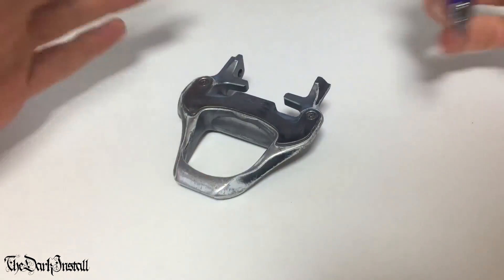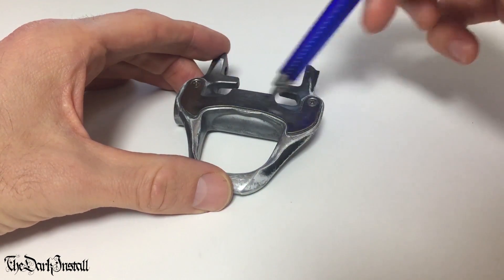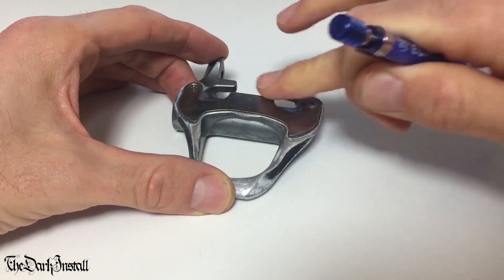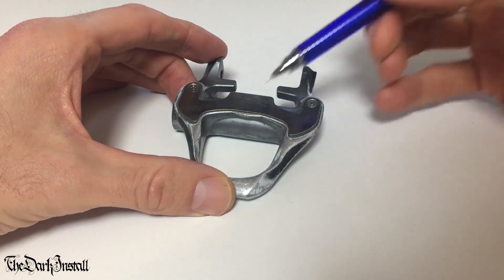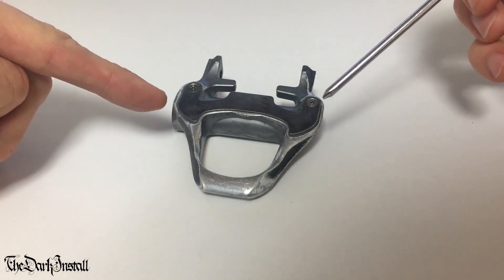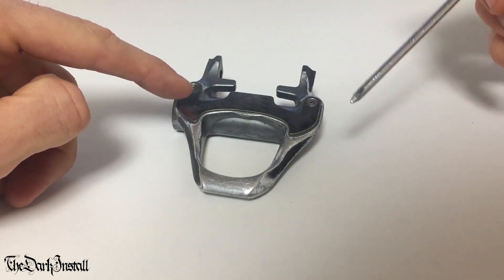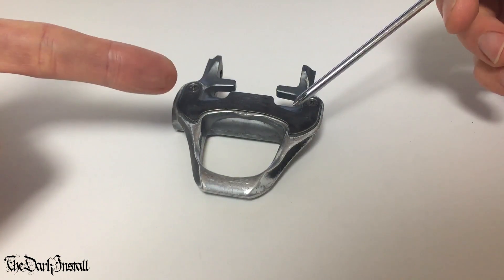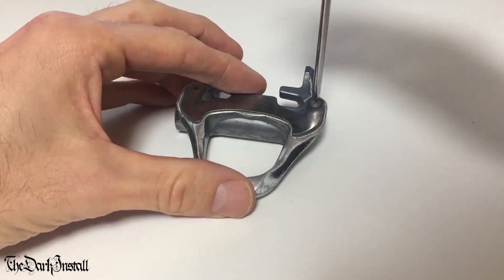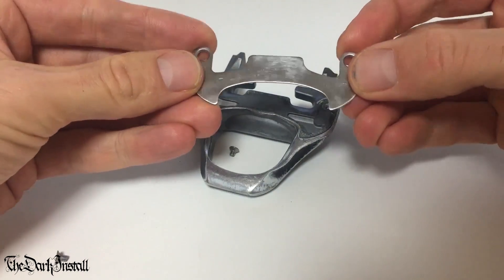This has got two parts: the main machined body part, and this plate here. This is a wear plate because obviously when you're riding, your foot's sort of sliding around a bit all the time. So they've made this replaceable - when you do wear through it, you can just unscrew it, put a new one on. The first good thing about Shimano pedals is I don't know anyone who's ever worn through one. I still haven't gone through mine and I've done a lot of hard riding on them. But if you somehow do manage to wear through one, you just unscrew it like this - that's the plate, just a very thin bit of steel.